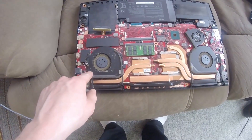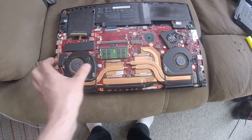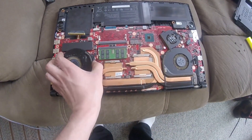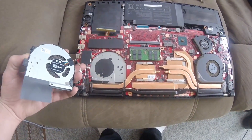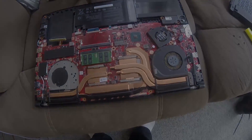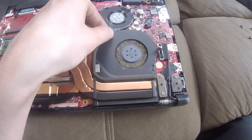You're going to want to take out a screw on your fan here, and here, here, and here. From there, you're going to very carefully angle your fan out and pull it up. Make sure to pull this clip, which comes out right here. I already took that one out, but this one has not been unclipped yet, so we're going to pull that out now.